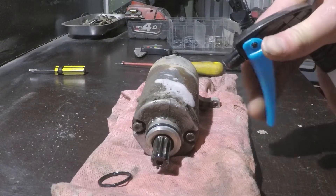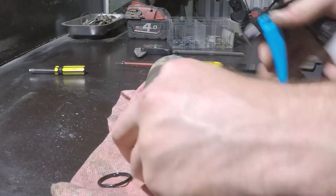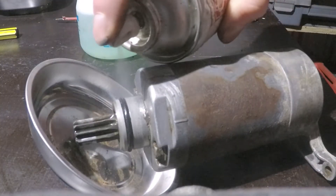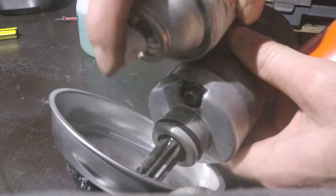Just give this a quick clean up, try and get some of that oil off from down underneath the bottom here so that we can tell if there are future oil leaks. Silicone spray on this so that it slides in a little bit better when we're trying to fit that slightly bigger o-ring on there. Just push straight back in — it was a snug fit this one — and then the two bolts back on the side, and then everything bolts back up.